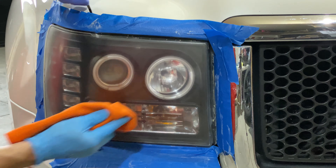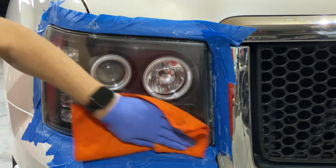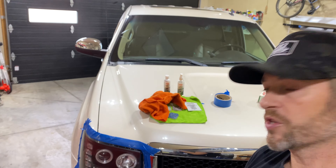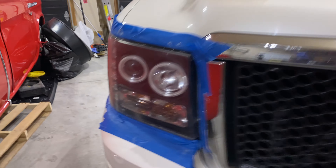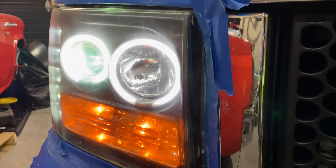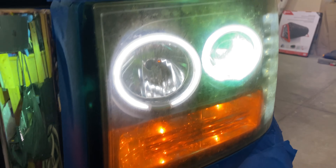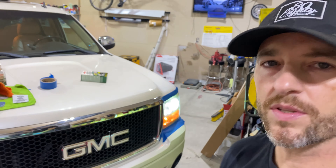Okay, it's been a few minutes and it should be dry. I mentioned I'm not going to put on the lens sealant until I get the other one done, so let's just do a quick comparison first. This one is one step away from being done; this one hasn't been started. Let's turn the lights on. So not perfect — I can still see some fogginess — but much better than the untreated one. Let me tend to that one quickly and then we'll apply the sealing wipe.